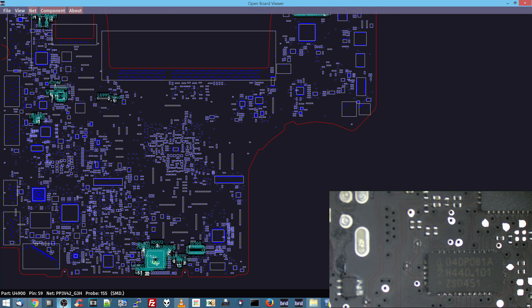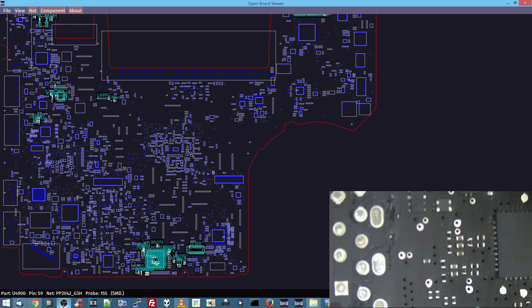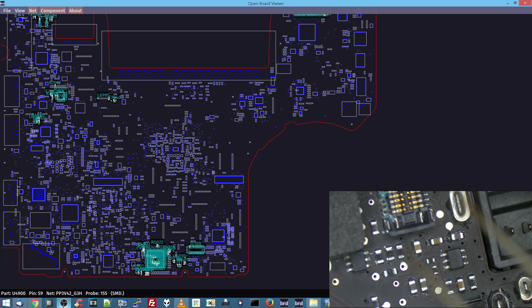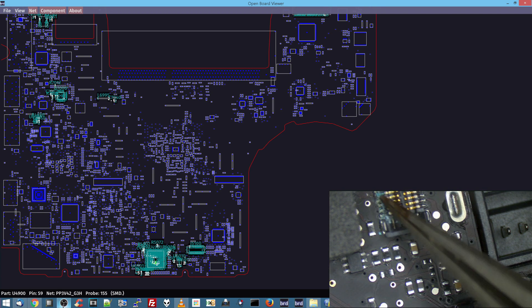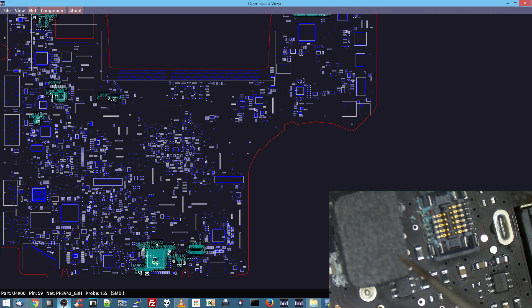Then we look over here — and there's something. But here's the thing: this is what gets people. You can see some corrosion, but what gets people is this foam. You see this foam? The liquid hides under the foam. Even if you spray freeze spray, it doesn't get under the foam. And if you don't take off the foam, you'll never see that little capacitor for the audio circuit.